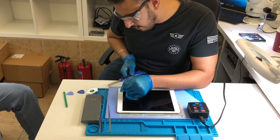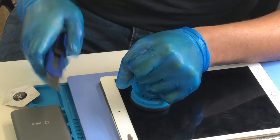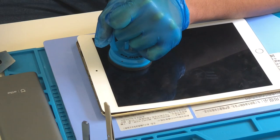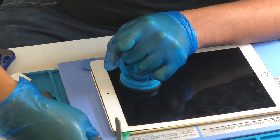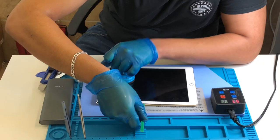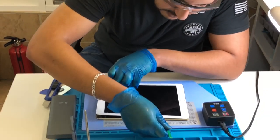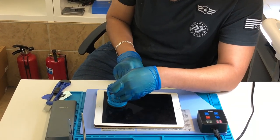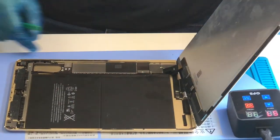We have connectors here on the iPad Air second generation. Put a suction cup on, hold it tight, try to pull up the corner. The corner is pulling out - get the blade inside. It's actually starting to come out itself, which is a good thing because the heat is already down there. One side comes out - just put a pick there and leave it. With the spudger, keep doing that twist motion. The suction cup is holding and pulling out - don't leave the screen down while the spudger is in there or it may break.